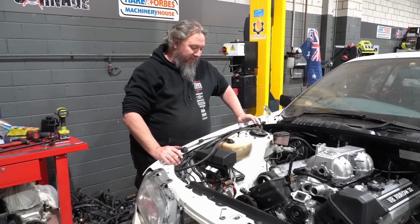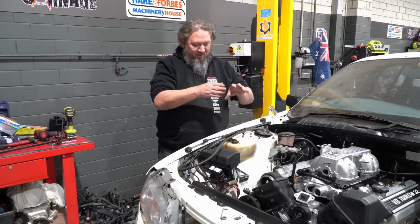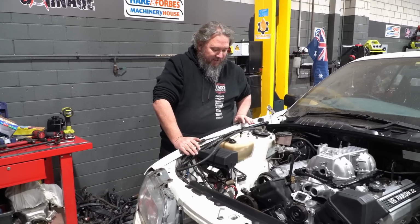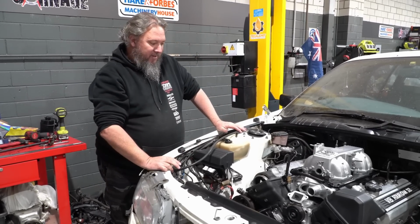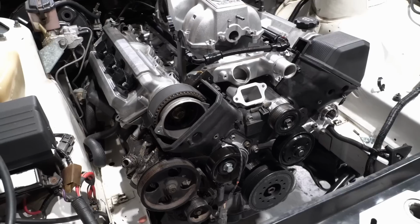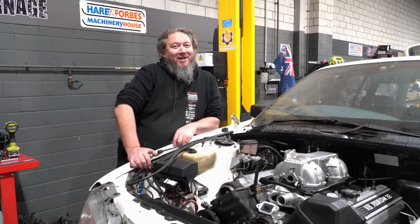And to clear both of them, I think we're gonna have to do like a hard 90 out of the front of our turbo manifold, sort of cut it back a bit, go hard 90 down, and then bring it in down under the alternator. Fun. And of course, for any of this to happen, the engine has to come out again.